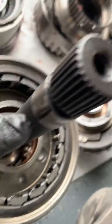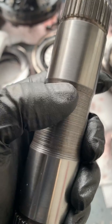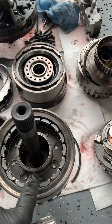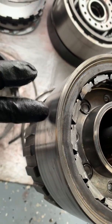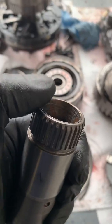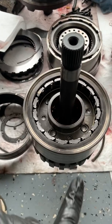What it did was eat the input shaft. This little cavity fills up with fluid — the transmission fluid goes through here and it literally becomes pressurized. Once pressurized, the valve will engage the pressure and it basically locks up, pushes on the piston with your reverse piston, which presses this together and squeezes around the drum — and that's how reverse happens. Because this was losing pressure through here, it wasn't able to pressurize the reverse band enough, and so it caused a lot of slippage.